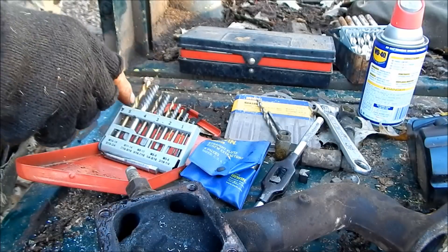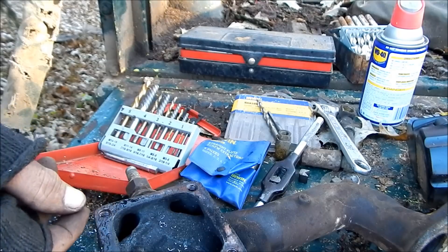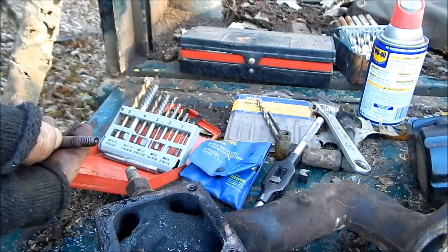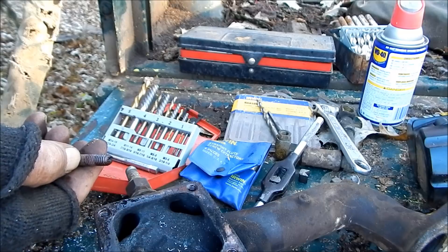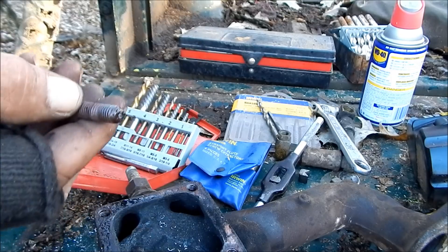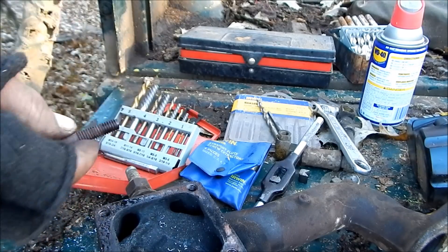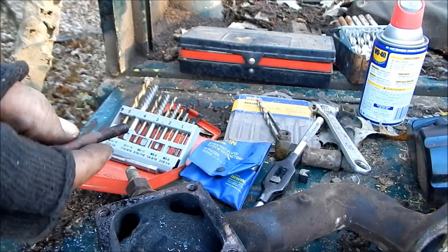When I first took this apart, there was actually about a half inch of the bolt sticking out. So I thought I had it made. I screwed a nut down there and welded it on, figuring it might come out. Well, it didn't. It snapped off just a little bit over flush — not enough to try to weld again. Normally if you've got an exposed bolt, welding works because it heats it up and helps loosen it. But sometimes on manifolds, this stuff is like permanent in there.